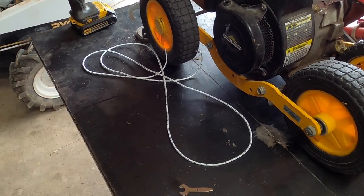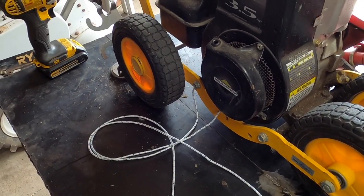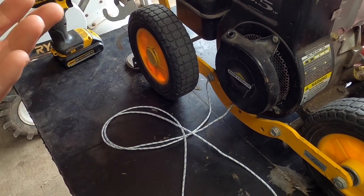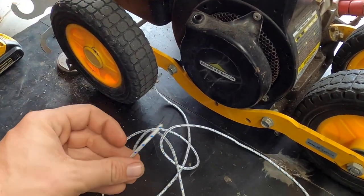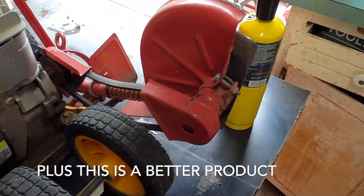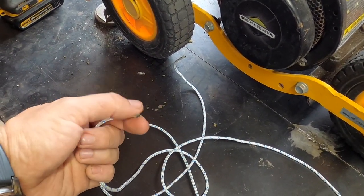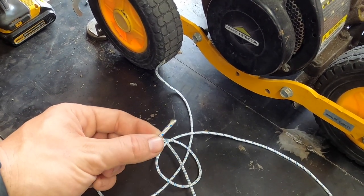You need to account for that, but you can buy this in a big roll because it's kind of cheaper that way. A big roll is like 60 feet and it's like ten bucks. One kit at the local hardware store was eight dollars, and if you do this again with another machine you saved yourself money. If you buy the roll you have to make sure to burn the ends — I just use map gas or propane — and when it's hot you make it come to a little bit of a point. That keeps it from fraying.